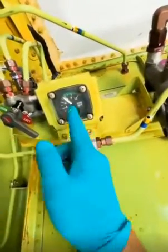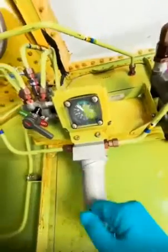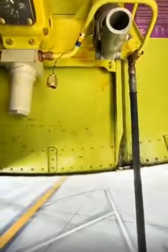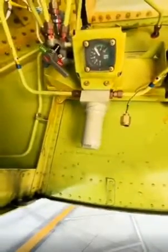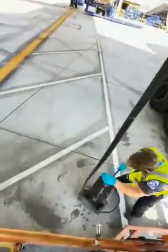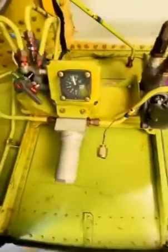As you can see, the right side has gone low a bit. It's okay — we monitor this all the time, get an indication in the flight deck, and check this on every flight. You can see we attach the fitting and my partner downstairs will begin to pump. As he pumps, I will monitor the gauge and let him know when it's at sufficient levels. Just one small part of what we do — there's a lot more that we inspect.